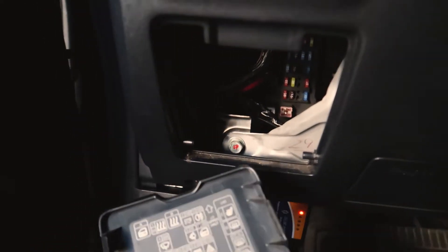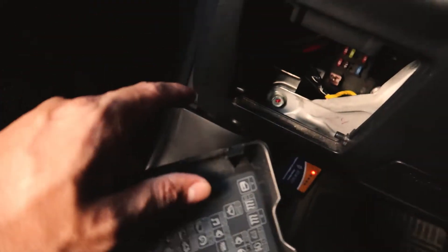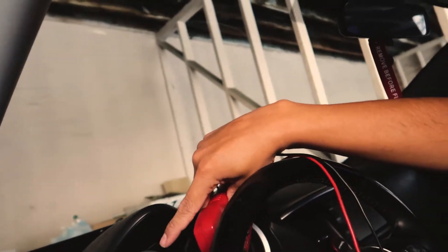If you have a 2008 Mitsubishi Lancer like mine, there's a panel that we're going to be looking at today. There's another panel in the hood but we don't need that right now. What we do need is a multimeter with long enough leads — this one's decent enough that we can put them on the windshield so I can see it from inside while I take out the fuses one by one and see where our voltage drops.